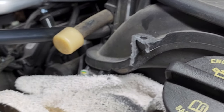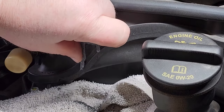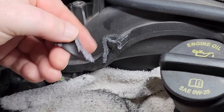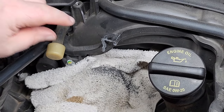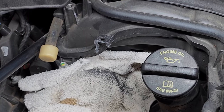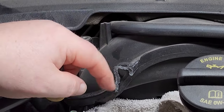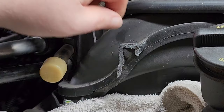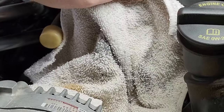You can see I got it cut off now. If you want to go back and cut some more off or trim it down you can. I just wanted to cut this little piece off to have enough clearance to get that filter started in there. Like I said, it doesn't cut into the intake or anything, so you're good. If you want to clean it up and make it a little prettier you can, but it won't hurt anything. You can see I caught all the plastic shavings in the rag.